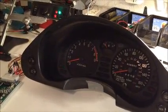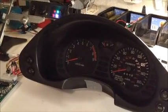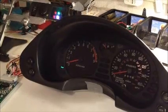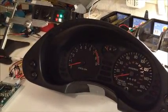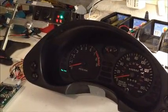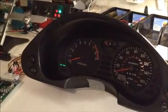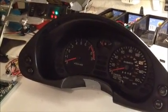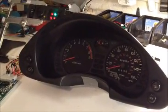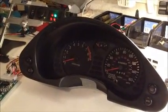Once it's finished with strut three, it moves on — four blinks — testing the fourth strut, right rear. Four fast blinks tell you that the fourth strut has failed. That's the sequence I'm using for the diagnostic mode when all you have is the console. It's obviously easier to interpret if you're using LEDs. I'm interested in your feedback on that sequence. If you just wait at the end, it's going to start over and do the diagnostic routine again.